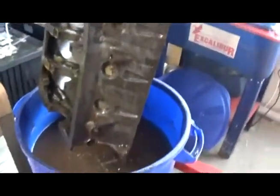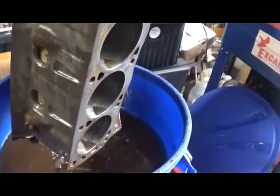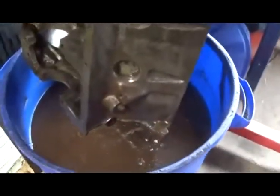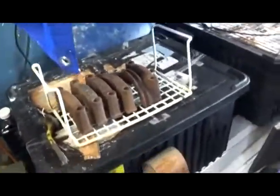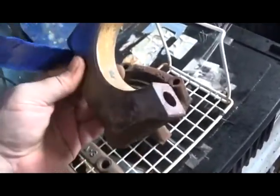That is outstanding. We're going to go give it one more over with the brass over copper brush and clean up some of the hard to get spots. We're dropping this on the deck — there's no sense in this going back into this goop. And then we've got to do the main caps. That has to go through electrolysis, or at least the vinegar bath — I'm thinking electrolysis, because they're pretty bad. And somebody didn't take the dang stinking bearings off, I don't think.